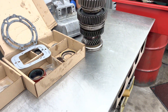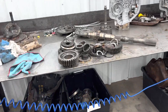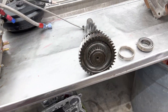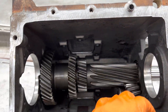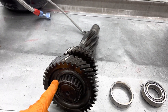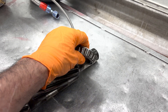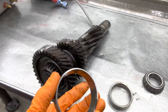I'll show you real quick - you can see here the stack of parts that is coming out of this unit that we're getting rid of, not counting the cluster shaft. We've got the cluster shaft in the housing already, and I want to give you an idea of how we do this. We'll be pressing a bearing on here on the end of the cluster shaft. This bearing diameter on the inside is bigger than the rear bearing, but the races are identical in outer diameter - they are different in the center though.